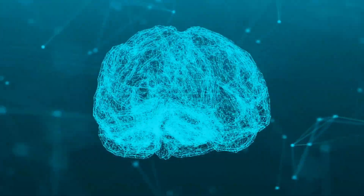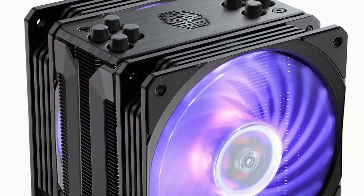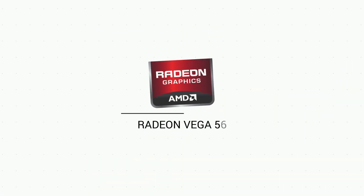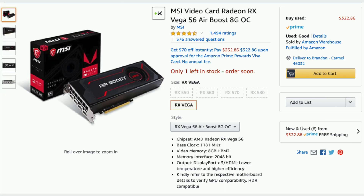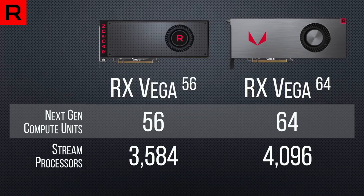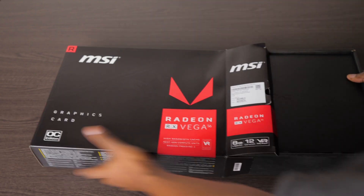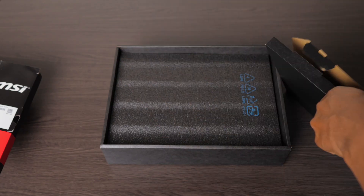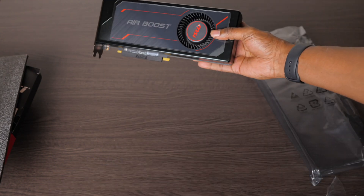Now onto the graphics card. I really debated on which graphics card to use, and ultimately after a whole bunch of research, I went with the Radeon Vega 56 GPU. The Vega because it's known to be compatible with Mac. The 56 was really good because it was right at the price point before going to the 64, where the speed and cost really exceeded the value I needed. If I would have gone bigger — the Radeon 7, any of those — I might as well just purchase a new machine, and I didn't need to do that.